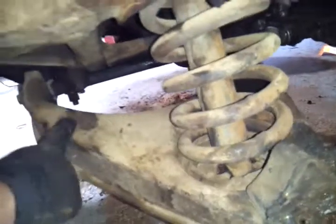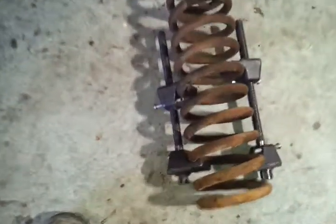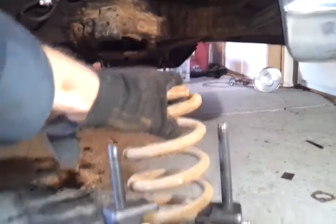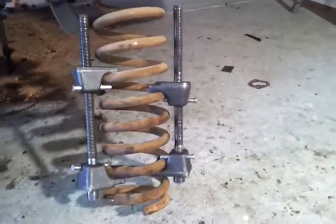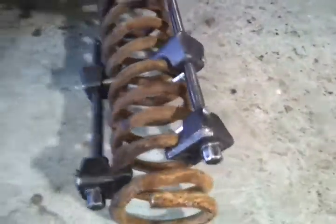Lower it just enough to be able to reach into the spring and put some fingers on it. I was able to compress mine from the passenger side — while I was up inside there I was able to just barely get enough on it so the shaft didn't get in the way. I compressed five spring portions, at least enough to pull that lower control arm off. Just be very careful — these springs can kill people.